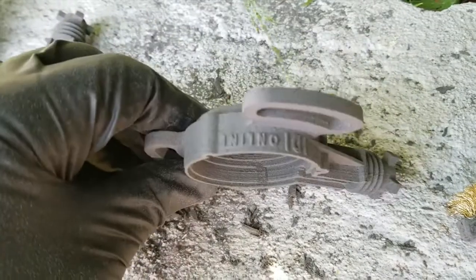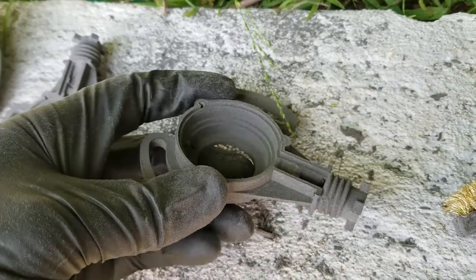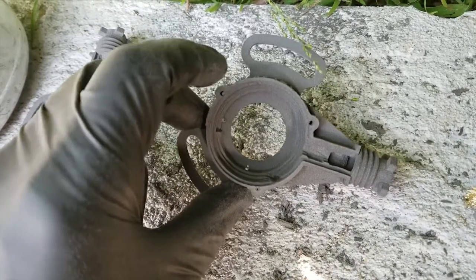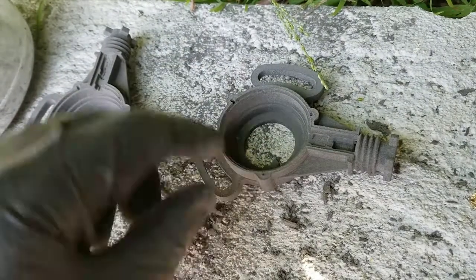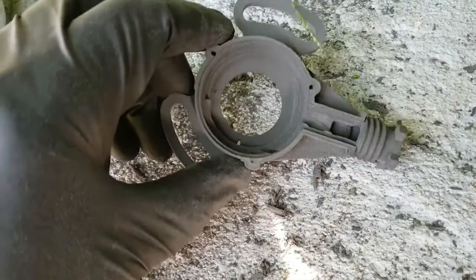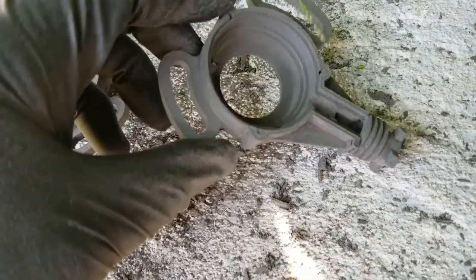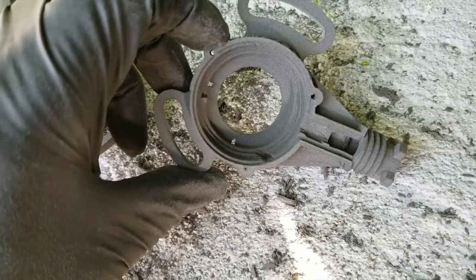With enough scraping it cleans up — it's not that bad. The only bad part is that unlike other areas where you can just rub around with a dental pick and it'll make a hole, certain tiny holes just won't clear that way. So I got a little drill bit set and I'll just hit those with a drill bit. That's the only downside — if you've got passageways and you overheat it, they're basically fused solid unless you can get at it with a drill.